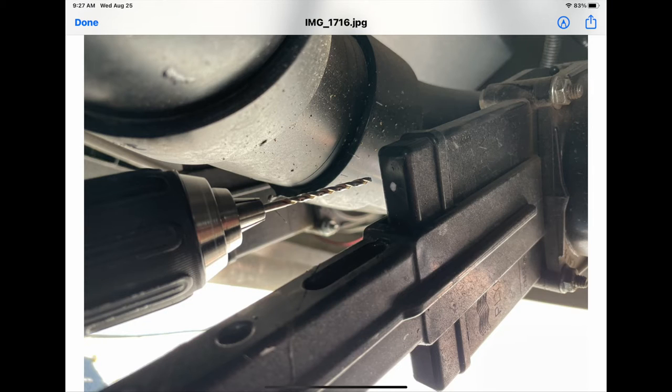Recently we had our black and gray — mostly the gray water valve — would not close, and it literally took two people to push it in or pull it out. So I started doing research on what we could do to maintain or fix that. One of the initial approaches you might have seen on YouTube is to drill two holes by the valve and inject white lithium grease. We tried that and unfortunately it did not help.